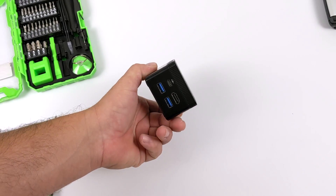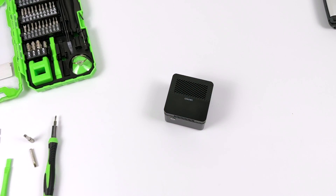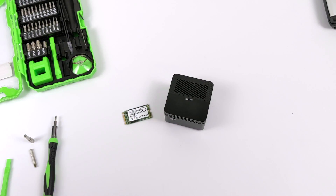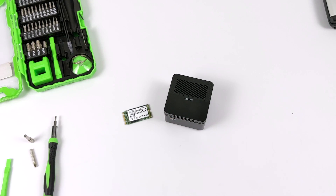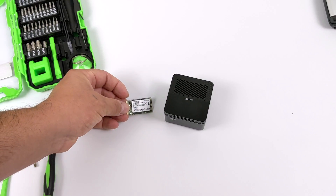I have done a review on it — I'll leave a link for that in the description. I do have a couple more videos coming up, but in this video we're going to be doing a teardown. We're going to see how this thing's assembled, and I'm also going to be adding a 512 gigabyte M.2 SSD. This does come preloaded with Windows 10, 128 gigabytes of storage, 6 gigs of RAM, and the Intel Celeron J4115 CPU. They have left us an open slot on this unit so we can install a 2242 M.2 SSD up to 1 terabyte.